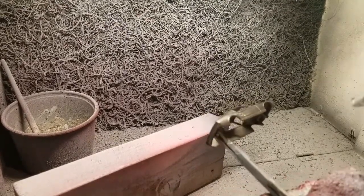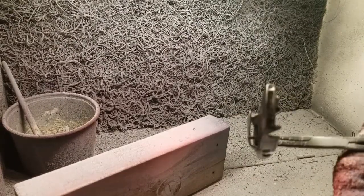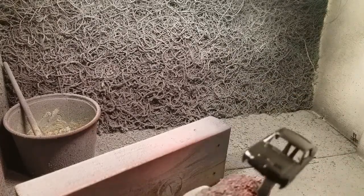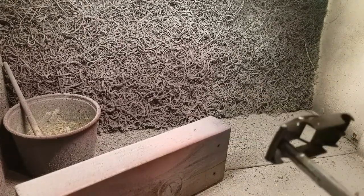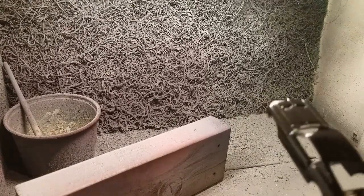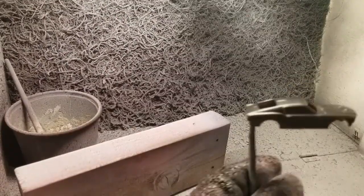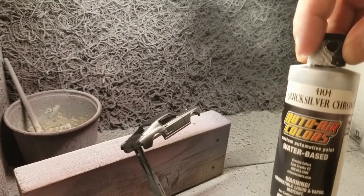You know, it does take a really good cleaning after you use the sealers, more so than it does, say, any of the other colors or the candies or whatever. It does take a nice thorough cleaning after to get the sealer out. But we're just going to layer the sealer on nice and light. It does dry fast. A lot of times if you don't get it real wet, by the time you get back to the first side from the other side, it does tend to already be dry. You don't have to wait so long in between.